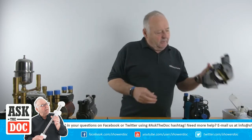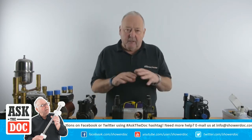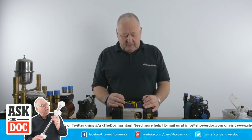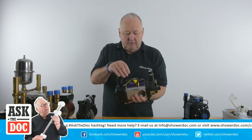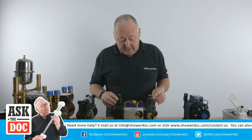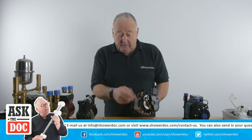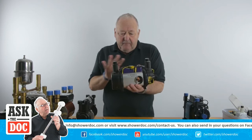Then we go on to this kind of thing, which is really regarded as a shower pump, but this has been cut away so I can show you what all the bits are for. All of the other pumps really have the same kind of parts inside them. They've always got a circuit board mounted usually on the top, sometimes on the side. Inside we've got the motor, very similar to the motor in the first shower I showed you. And at the end, the actual pump with the elements inside — the impeller — that drives and builds up the pressure in the water. So that's the basic structure of the pump.